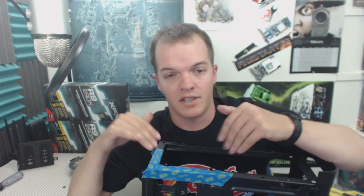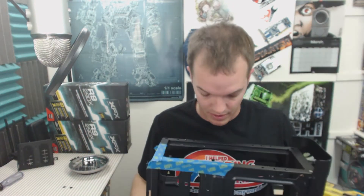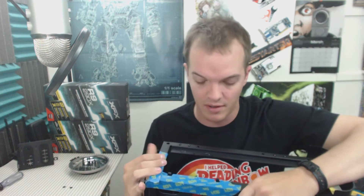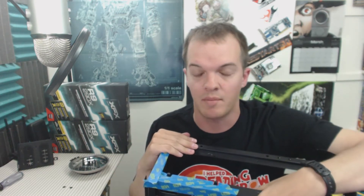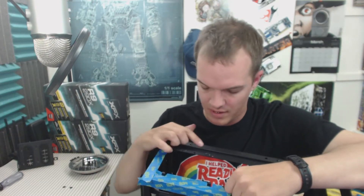The first couple of things I went ahead and did: I tore down this case and completely stripped it of all the components just to free it up. I put the tape on here — it's low-adhesive tape so you don't have to worry about using Goo Gone or anything; it shouldn't leave any sticky residue. I put it all over the top just as a way to protect it from my dremel work, because if it hits the tape it won't leave any gouges in the case and paint. As for why I don't just bend the tabs out of the way — I really don't have a way to do that cleanly, so I'd rather just cut them off, make it flat, and forget about it.